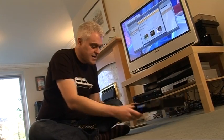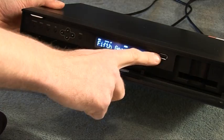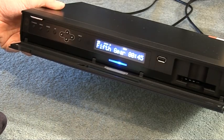There's 320GB of hard disk space, which should be enough for quite a bit of recordings — probably around 150 hours at standard definition. But if you need more, you can connect an external hard drive via a USB socket; there's one in the front and one in the back. You can also use that socket to transfer music and photos onto the device if you want to use it as a multimedia hub. It's very quiet, barely makes any noise at all, and uses under one watt of electricity on standby. It does take a while to boot up, and it's also rather expensive at about £300, so although there's no subscription, there is quite a bit of capital outlay. Having said that, it's a superbly engineered bit of kit and a great addition to the TV landscape.